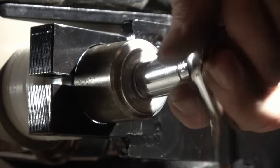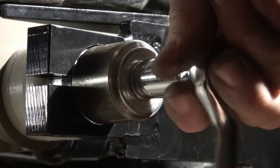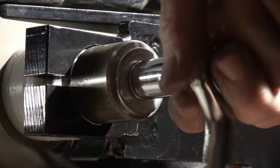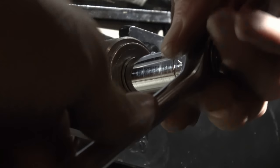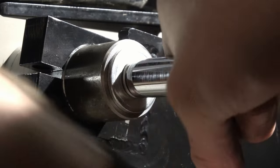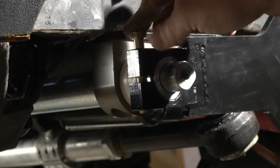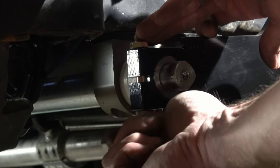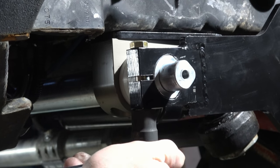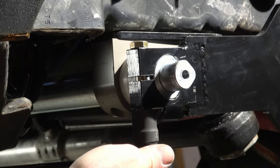Same as before — if everything is lined up it should go pretty smoothly. In this case we're looking for the end of that torsion bar to go all the way to the end of that arm. Once it's tightened down all the way, you'll know it — it'll all start to grab. Now I'm going to go ahead and put a bolt and one of the lock nuts onto the inner torsion bar and lock that in place. You can see how that inner larger diameter bar goes all the way to the very outside edge of that inner arm.